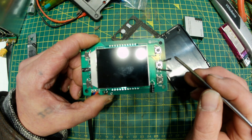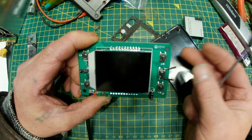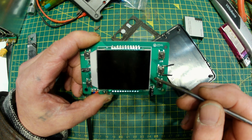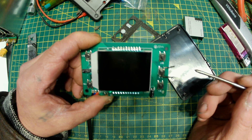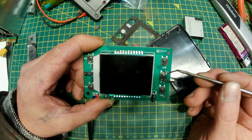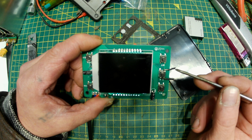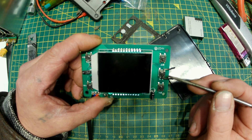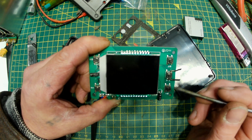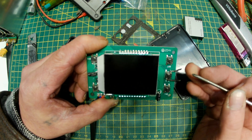So you just hold the wire onto the bottom and wire onto the top, which gives you your remote wire. The remote it comes with is like a little radio frequency — they're not very good, half the time it doesn't work; the one with this didn't work, it's in the bin. One wire there, one wire there. Can't go left to right because it won't work — you'll just short it out. It's top to bottom on these; they're all the same. The board might be slightly different but the middle, as long as it's the on/off switch, that's the one that matters.